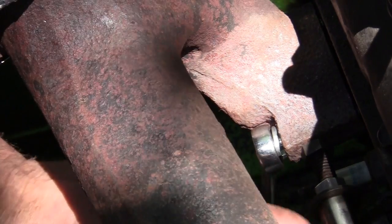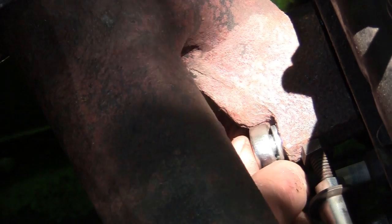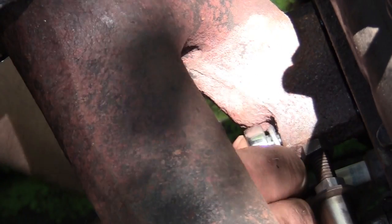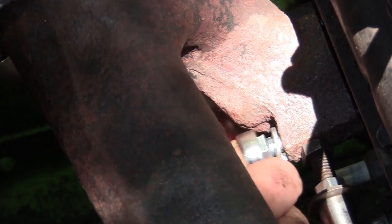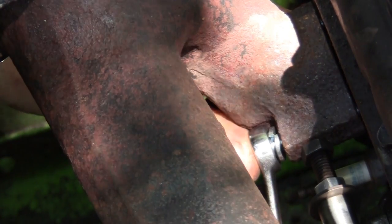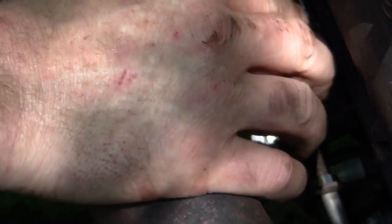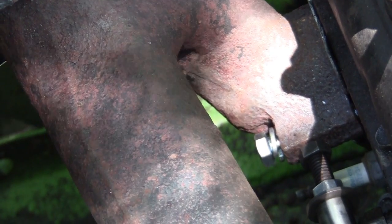With some struggling, this expander tool is kind of hitting the temperature sensor, giving me some grief because I can't tilt the manifold to the right angle for the bolt to start. But I think I got it now. I actually tapered the end of the bolt just slightly so she would start. I might have it now — there it goes. You want to be careful not to cross-thread these. I think that's good there. I should have probably drilled them out too — would have made life a lot easier. Now I might have to get a screwdriver in there and pry that apart to put my exhaust gasket in. The bolts are kind of short — should have got two and a quarter inch bolts instead of two inch.